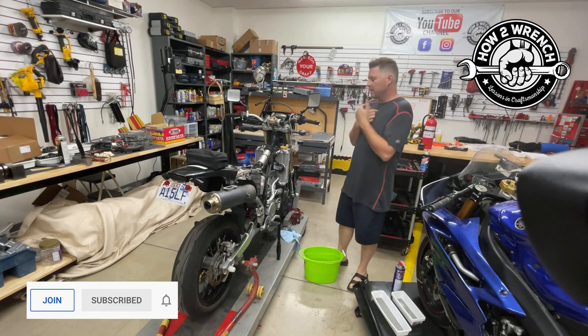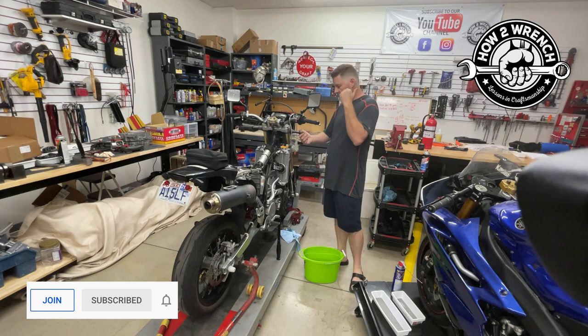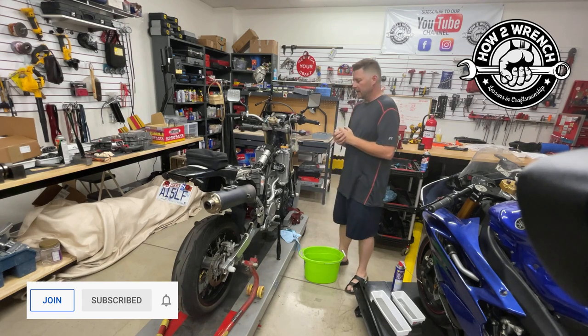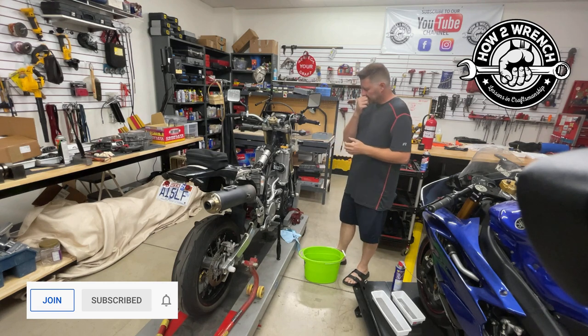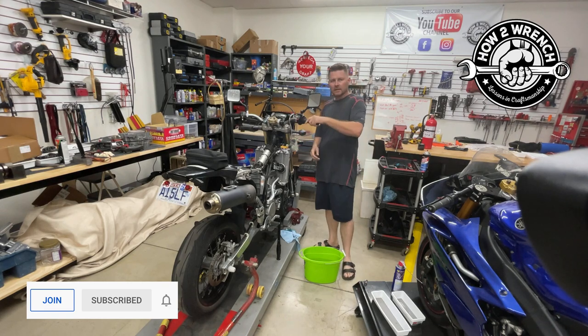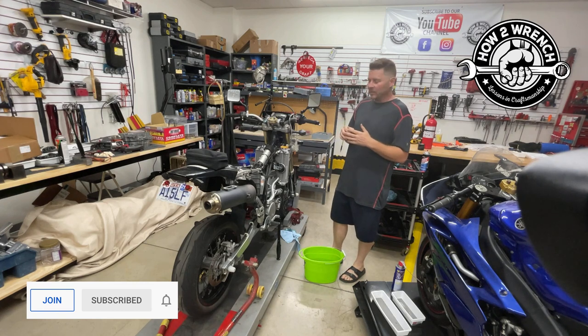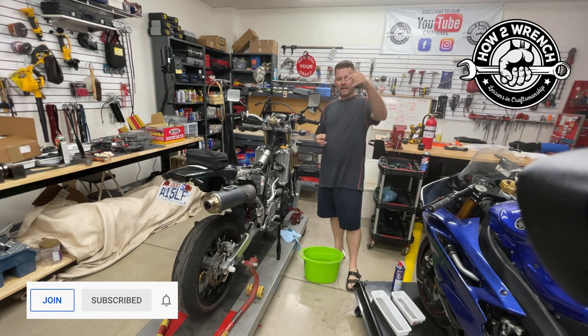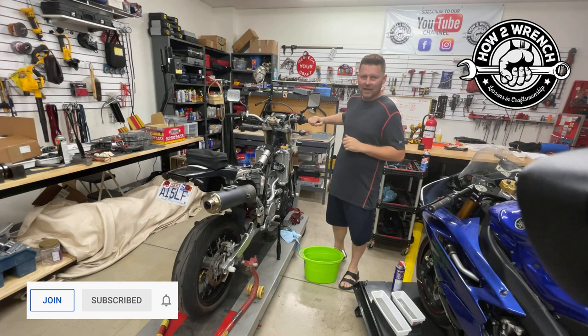I had to redo the carb on this, unfortunately. I have a video called 'The Most Overlooked Place in a Carburetor' — textbook same thing; that was causing the engine to flood, all kinds of grief. New spark plug, check the condition — the old one was flooded so it didn't give me good data. Had to put a new air filter in it, clean the intake track, adjusting and lubricating cables. This bike is going to be severely modified by the time we get done — it's going to be pretty cool. Of all the content, I thought this would be the best thing that could directly help you. Go to Amazon, grab that link, get this in your garage and your toolbox, and do the wrenching yourself. Thanks for being on here — subscribe, like, share all that good stuff. As always, make it a great day. Stay tuned to see how we do on the track with this, and keep wrenching.